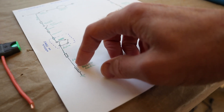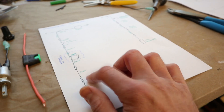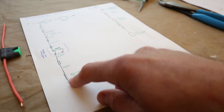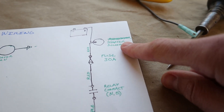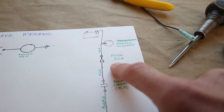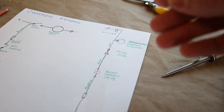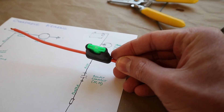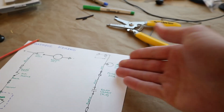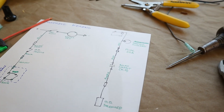After that we come back up to a relay coil. The relay is mounted up under the passenger footwell. That's just grounded out — so that's your circuit to control the overdrive. Over on the power side, we basically come straight off the battery — we're gonna use the starter solenoid tap. I did have a 30-amp circuit breaker near where that relay is; however, we found the circuit breaker doesn't actually work with the solenoid — it just seems to want to trip. I'm not sure if this 30-amp fuse is gonna be enough. Triumph didn't put anything in here for circuit protection, and I'm not really comfortable with that, so I want to add something. We'll start with this 30-amp and if we need more we can always go up from there.